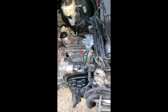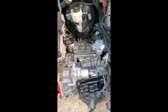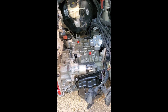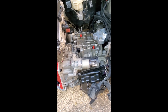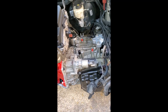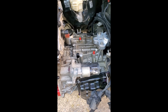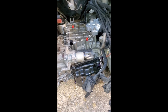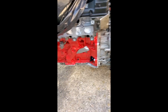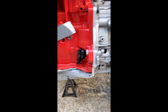I discovered that Don Octane and Donkey Tech have already had machine gears built for the DQ500 transmission. We need to source and order those gear sets, because if they're busting these transmissions apart with a five-cylinder — which doesn't make nearly the torque a VR6 makes — we'll blow the transmission case apart. I've also come across better hardware for the oil pan and girdles, correcting things from what was originally sent.